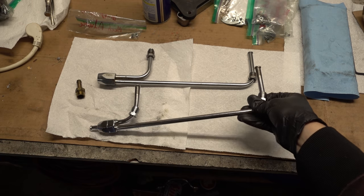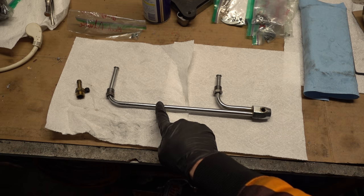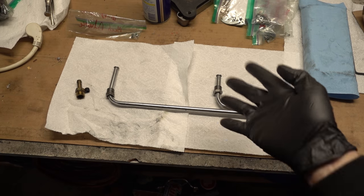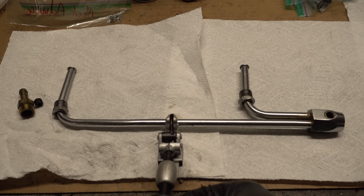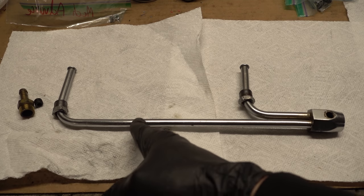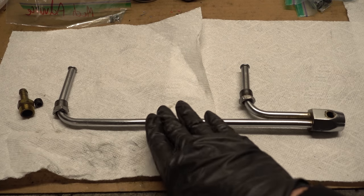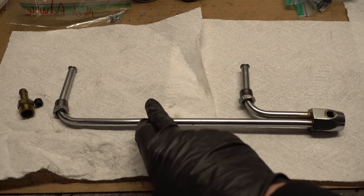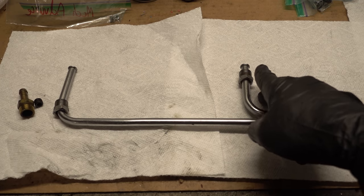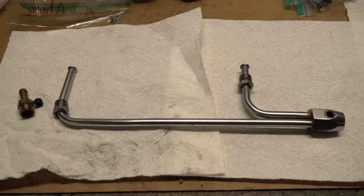So for now the 4160 line is going in the parts bin. But what are we going to do about the spacing between these fittings? What I'm going to do is cut this thing and flare the ends — hopefully I can flare it if this tubing isn't too thick — and then clamp on a piece of rubber hose. Besides being length adjustable, the added benefit is that the fuel bowls can be removed without unhooking the fuel lines, and this costs a whole lot less than any of the fancy flexible line models.